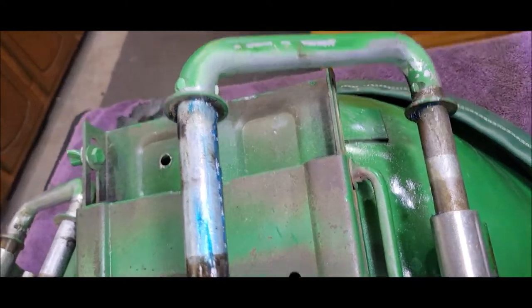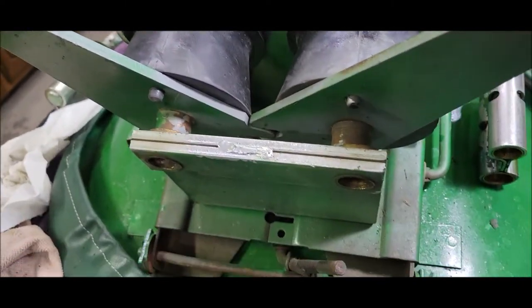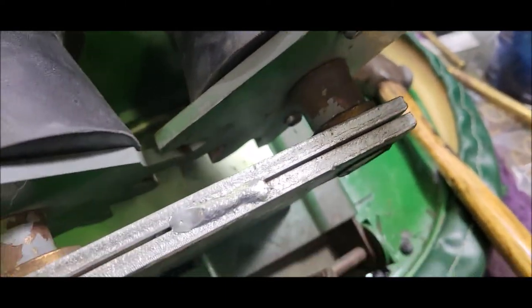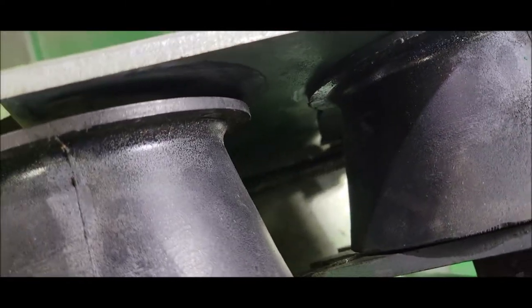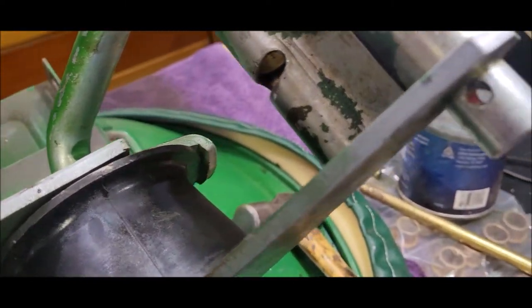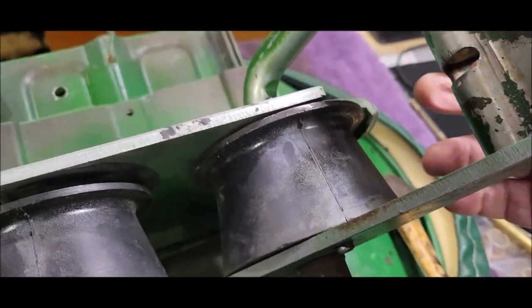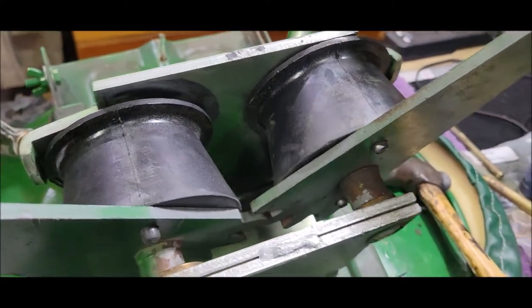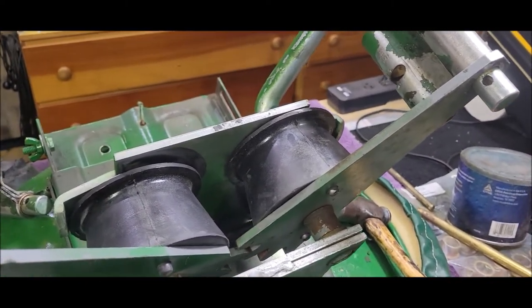Now I've got to wiggle this big loop bar through the rubbers and into this, and then do that again. We'll see what kind of a fight it is. I got this one in — I think everything's okay. Everything lines up; the little tooth there lines up. I don't see anything wrong. All that's left on this side is to knock that pin in. I did not change the bushings because they're nice and firm. I'll get this other side in and we'll talk about sliding it back on the seat bracket.